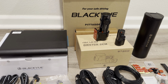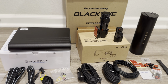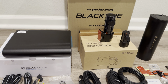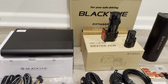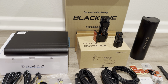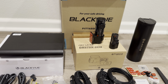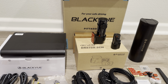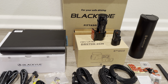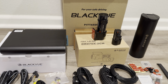And also, if you don't know this, if you leave your car parked for about a week with Sentry mode on, your battery can drain 60% or more, depending on the traffic. So we always have to turn off Sentry mode during long-term parking at the airport or at a friend's or family's house while you're away. This might be the solution. You can turn Sentry mode on whenever you need it, and turn it off for the most part when you're away.